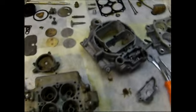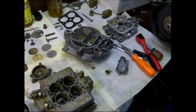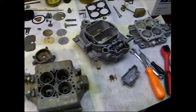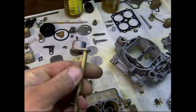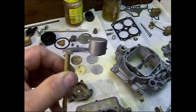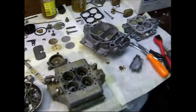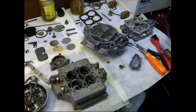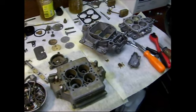And it looks like the stuff did a pretty good job. And I blew it all out. I'm going to double check all the air passages one more time and make sure there's nothing plugged up. And I got a few more items to work on. All these ends of all these shafts were kind of rusty, so they're going to get bead blasted, and I'm going to give them a shot of that Eastwood clear coat made for bare metal. And that seems to really look good. It's a satin, so it looks like it's just bare metal. And I've used it before, and we'll see.